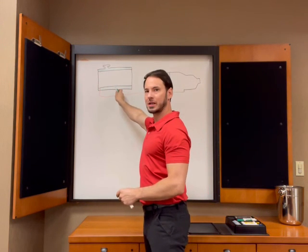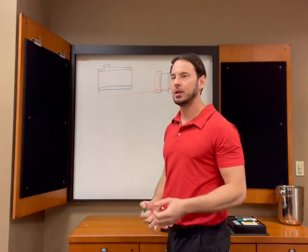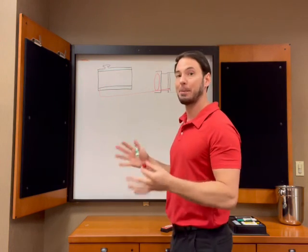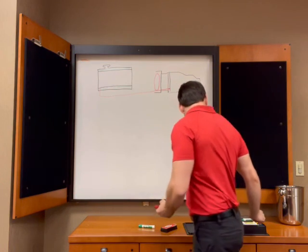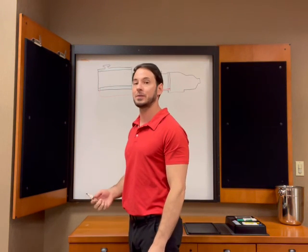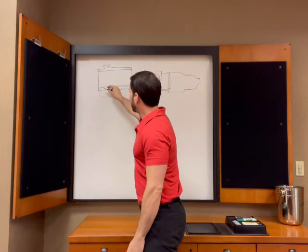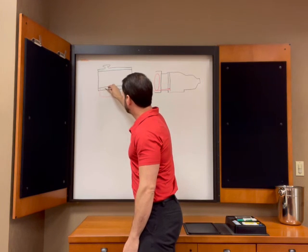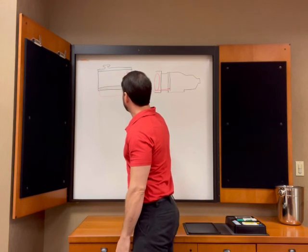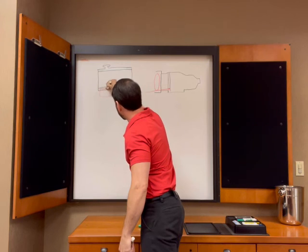But what's going on down here in our lower tank? Well, down there we have, it's usually made of copper, a copper pipe. There are various different things that you can do down there, but just for simplicity, I'm gonna say it's a pipe. So we have down in that area a piece of copper. I haven't seen one of these radiators apart in 15 years, but I believe it is a pipe, and it's about half an inch in diameter. So I have my inlet here, right? And then I have a copper pipe right through here, so my transmission fluid is gonna be in here inside this copper pipe.